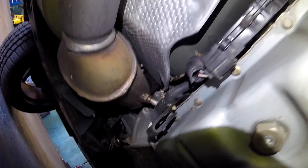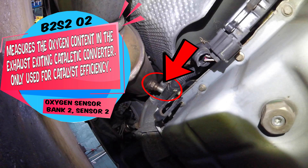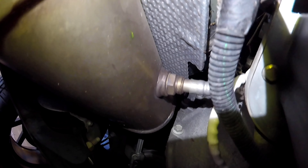Shimmy on over to the driver side of the vehicle and you're going to find the bank two side of your oxygen sensors and your air-fuel ratio sensor. You can see right there the rear oxygen sensor in the cat — that's going to be your bank two, sensor two oxygen sensor that monitors the catalytic converter. I didn't get a very good view of the bank two sensor one. You can see the green wire up there a little bit, but the sensor is actually on the outside of the vehicle, so you'd be able to see it from the driver's side a lot easier. Sorry about that, but it is there, I promise you, and good luck.